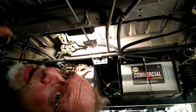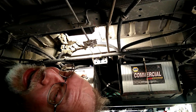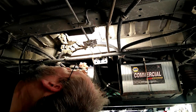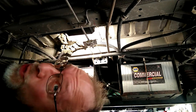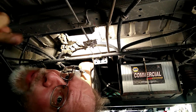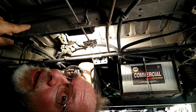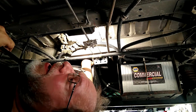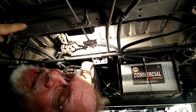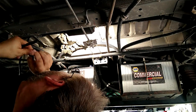If you are only swapping your two AGMs for two Battle Borns and not doing anything else, do not remove any of these cables. Pay attention to where they connect and put them back. The Battle Borns have the same connection style — the red positive and the black negative are on the same sides of the battery if you put them in correctly. It will be very easy if you keep the cables in the right places.